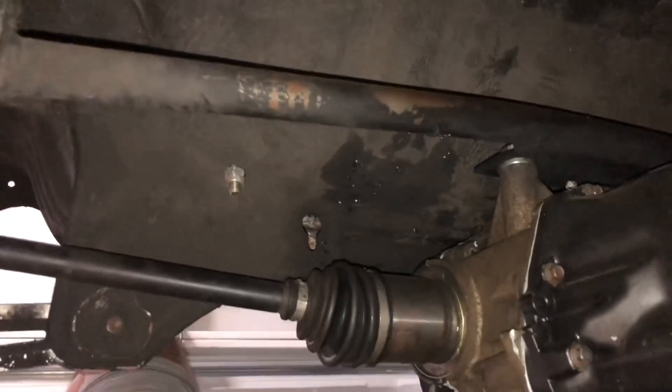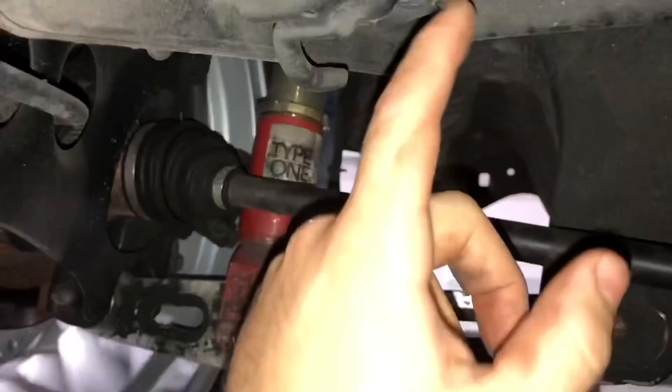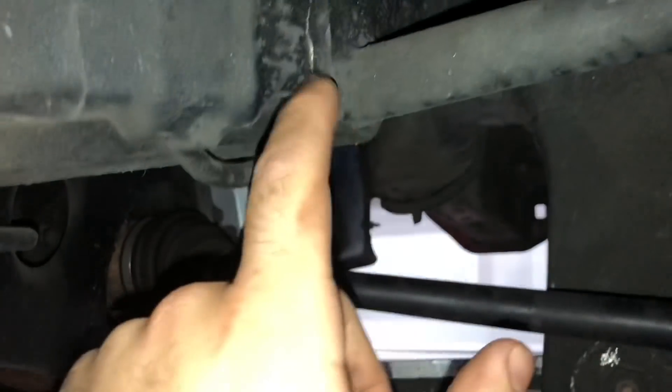You can see the front bar is bent, and the plates that came with the kit are kind of flimsy and really small. The contact spot has already started cracking a little - the body didn't adhere to the weld very well - and you can really see it bends all over. My biggest concern right now is I'll have to drain the fuel because I have a fuel line running right there. Once we cut this out and weld on the new bar, that's going to have to get welded close to it and I don't want any flammable liquid near our weld.